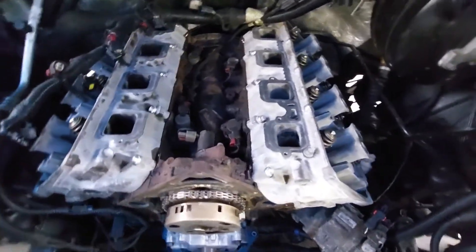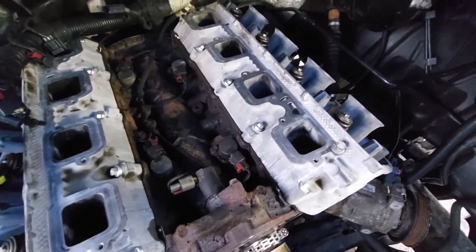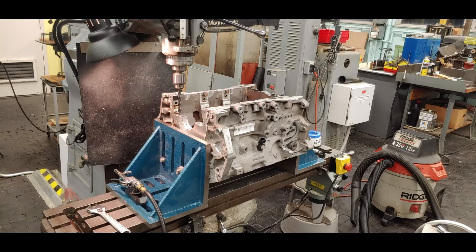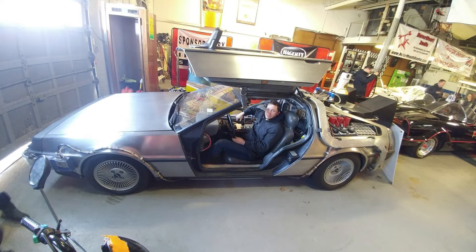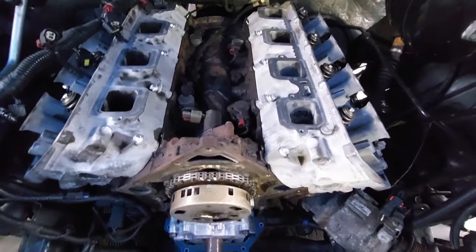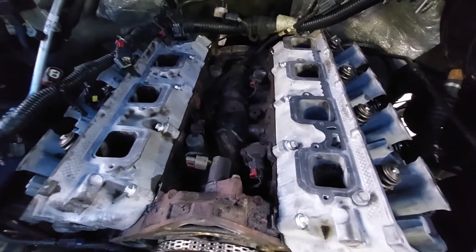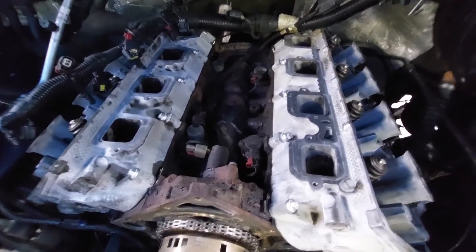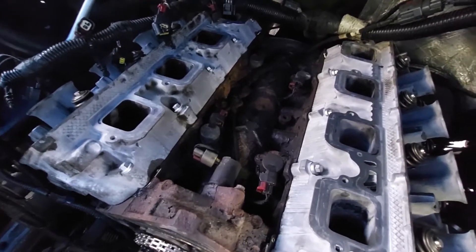As you can see, I got the heads on here already. Just wanted to note a couple of things. Before the heads go on, you want to lubricate the lifters with oil. You don't need to fill them up with oil — it's a big thing when you're breaking in the camshaft. The theory is the lifter, without having all the oil in it, is not putting a lot of pressure on the camshaft until the oil can get up to give it some lubrication. Just put a little assembly lube or engine oil on the lifters when you put them in.